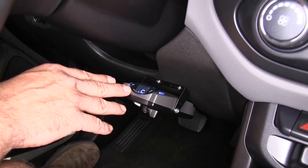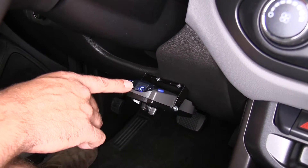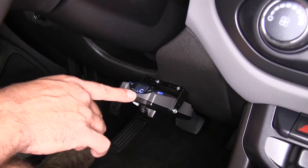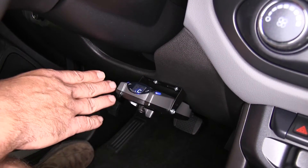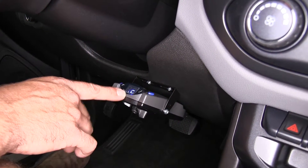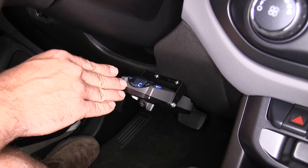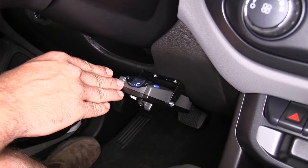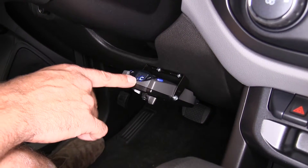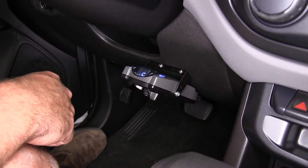The P2 has a few built-in safeguards as well. Not only does it inform us if our trailer becomes disconnected from the back of the truck, it also offers battery rundown protection — so once everything's shut off, if the 12-volt signal is still live after a period of non-use, it's going to shut off. Also, since trailers do tend to short out from time to time — sometimes in the lighting, sometimes in the braking — the P2 protects itself and our vehicle from that short getting into the vehicle's wiring system.